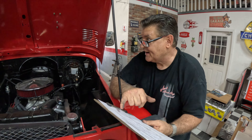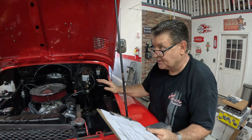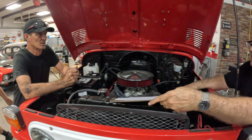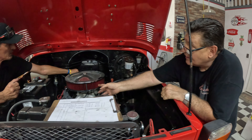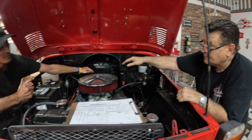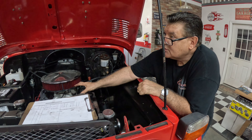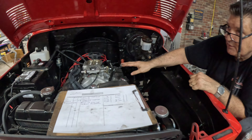You round off the numbers, wait a minute or so, and it didn't drop — so we're not bleeding. Those plugs are fouled; we're going to get a fresh set of plugs. Those are stock steel heads. We're going to go with a new set of wires, a new distributor, and the carburetor. For right now, go ahead and dismantle the EFI — remove the throttle body. I'll have Andy assist you with disabling the wiring.